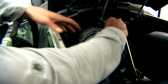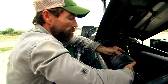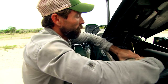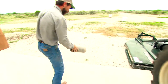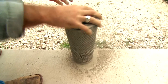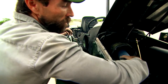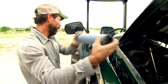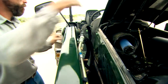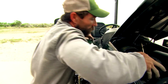Once the radiator screen's done, move back to the air filter itself. Based on experience out here running around plowing and disking, this air filter is going to be extremely dirty — and we want the air filter to be clean. This is a good example of how much dust can build up on the filter. Just take it out and slightly pound it to get the dust out. For general daily cleaning it wouldn't be this dusty, but we're going to go ahead and replace this filter. This tractor also has an inner filter, and while it's not as dirty as the outer filter, we're going to replace both for good maintenance. Here's the difference between a dusty one and a clean one — we want our filter to look like the clean one daily. That's part of just keeping it clean and going through your daily checklist.